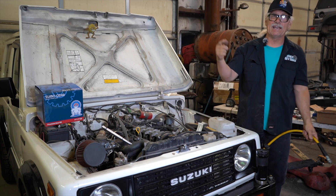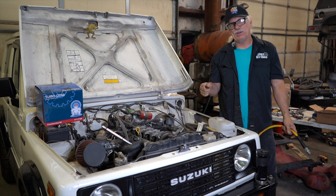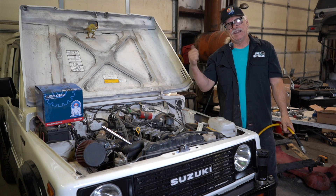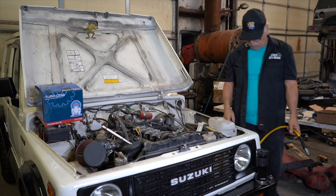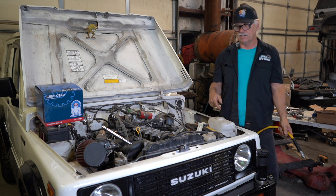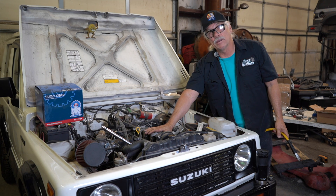We have no bubbles. You'll notice I didn't take the tool off — I actually rotated the motor accidentally — but I have the emergency brake on and the rear tire blocked so it didn't run over my foot, which was in front of the tire. So what I have here is no leak on cylinder number one.